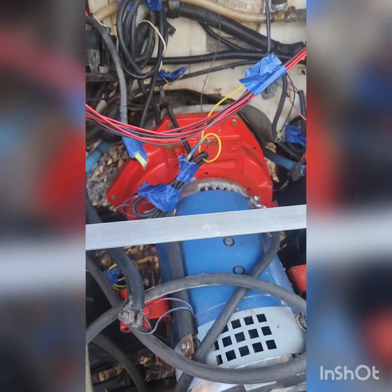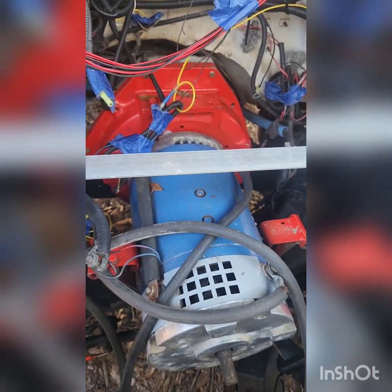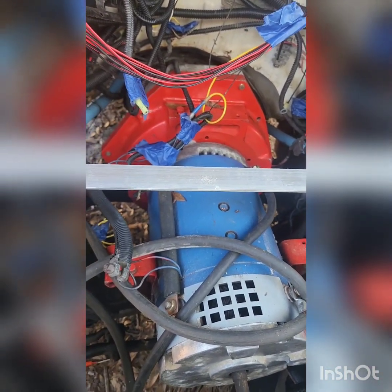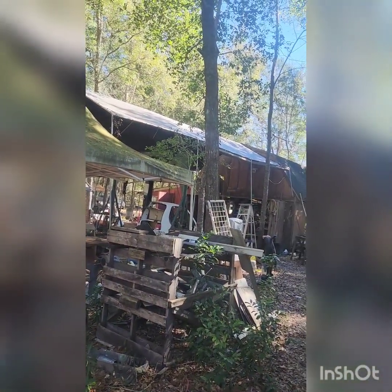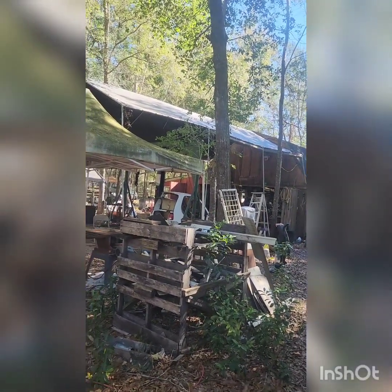Okay, so here's the motor installed to the transmission using that original Chevy plate. Painted it, cleaned the brushes, polished the commutator. Everything's nice and clean. Runs good. I'm able to take it around the yard now with the 12-volt battery, move it to different locations. Over there, underneath that big tarp, is a lift that I can put this truck on and bring it up and do work from underneath.